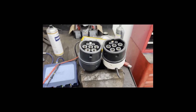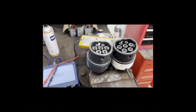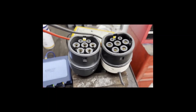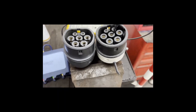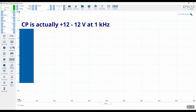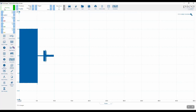On the right is the slow charger (mode 2, 2.2 kW) and on the left is the fast charger (mode 3, 11 kW). It's the CP circuit that's the issue. With a differential probe — gloves on, as both are plugged into the mains — we check the CP voltage, which originates from within the EVSEs. The middle pin is ground and CP is top left. On the mode 2 side we have plus 9 volts / minus 12 volts — there is activity. Moving across to the mode 3 side, we have nothing.